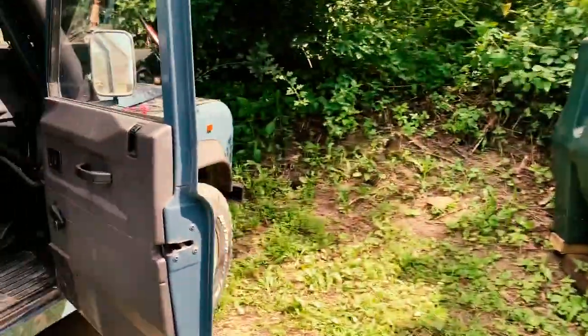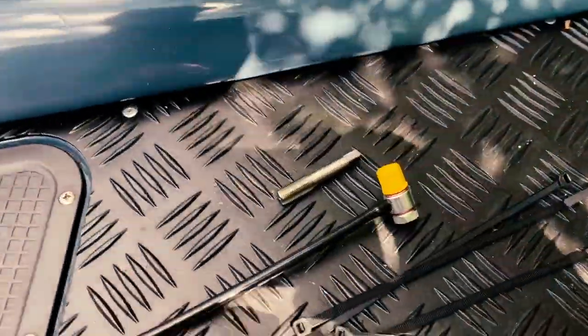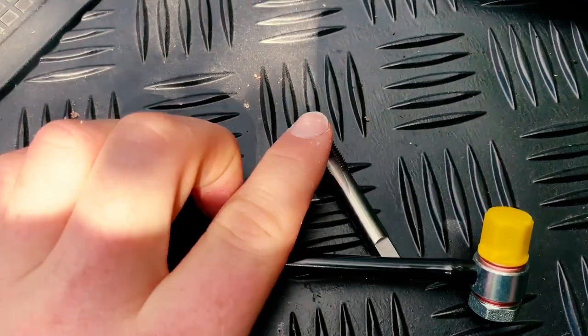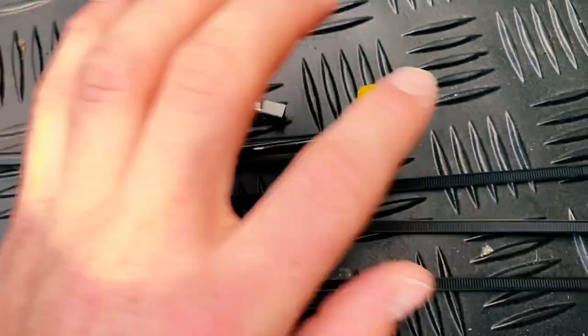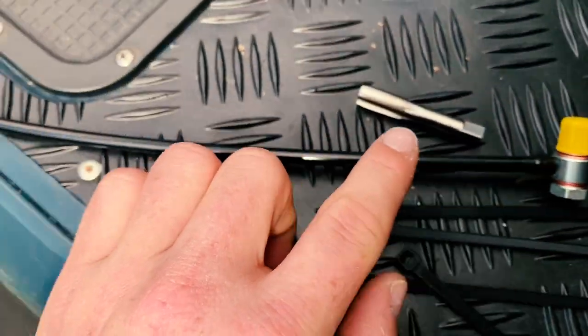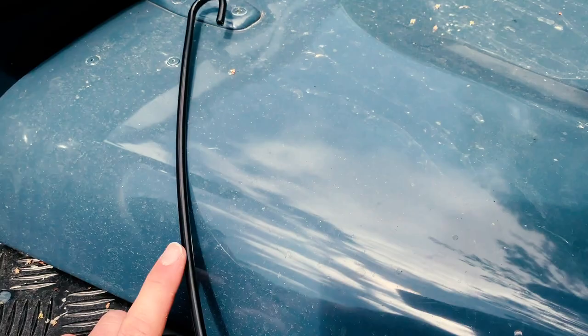What I'm going to do today is quite easy - I have to tap the hole that was there before, which was quite dirty, so that we can get this new banjo bolt in, and then wire this up as high as we can with cable ties.